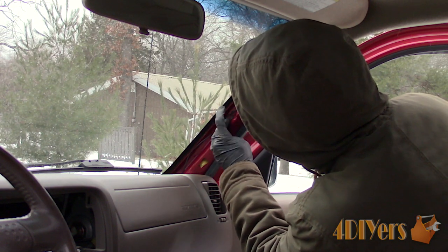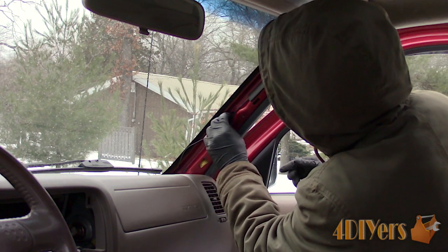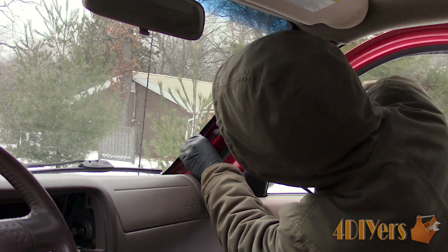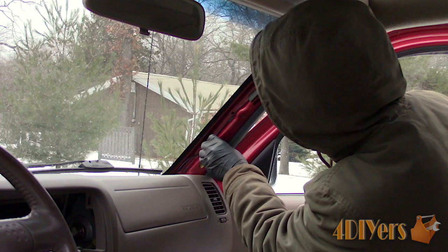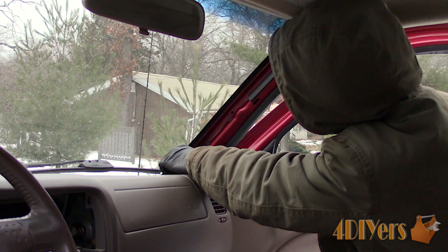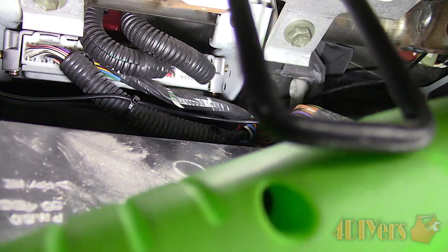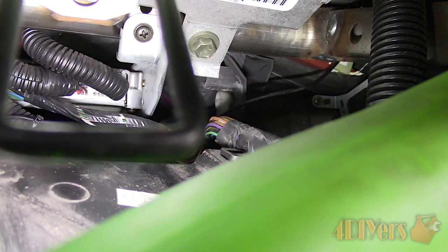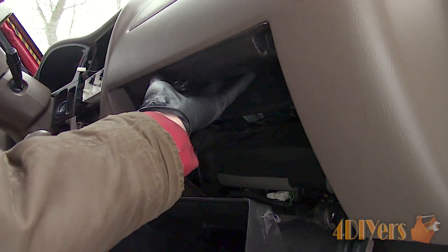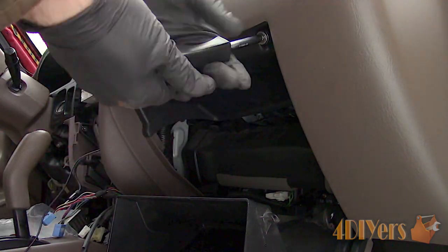There is also an HVAC duct actuator so keep the wires away from that as well. To keep the wire in place I used butyl tape — rip off a short portion, double it up so it is a bit thicker, and it can form around the wire when pressed into place. This will prevent the wire from rattling or getting pinched between any trim or clips. Here is a quick view of how I ran the wires. Use cable ties as needed to keep the installation clean and so the wire is kept safe away from any moving components. When done here, reinstall the panel above the glove box — snap it into place first, then reinstall the three 10mm bolts.